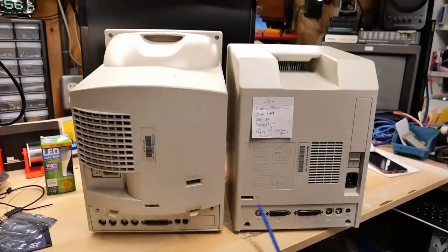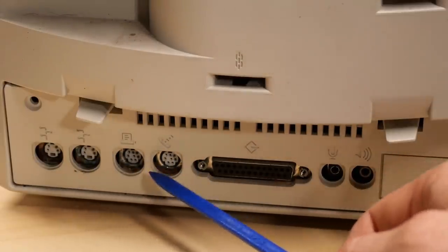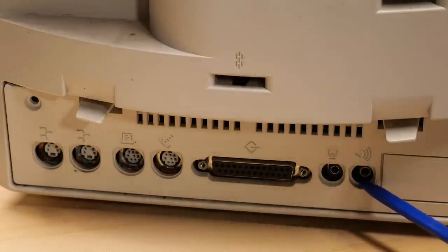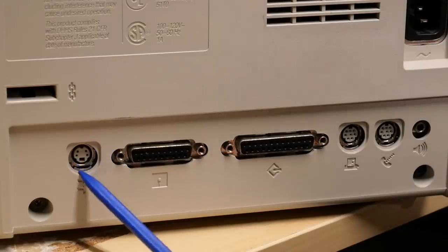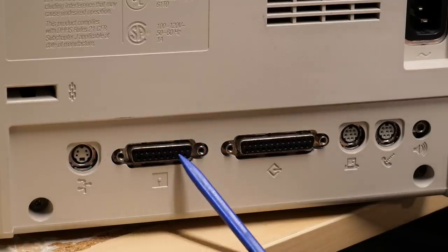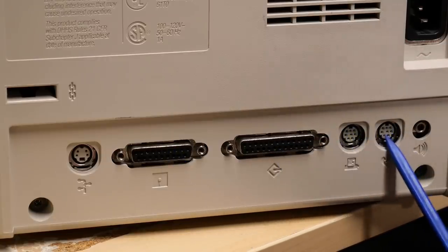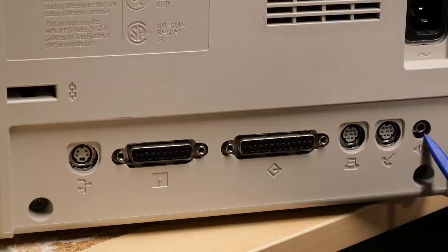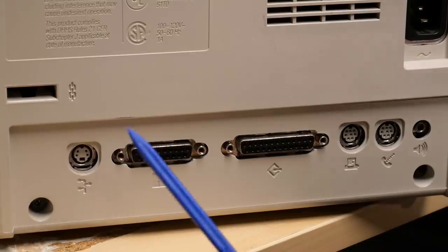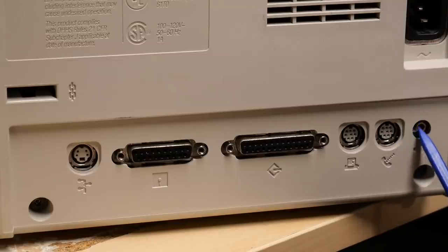From a peripheral port perspective, they're very similar. The Color Classic has two ADB ports, a printer and modem port, also Apple Talk port for the printer port, has a SCSI connector and a microphone input, and a headphone output. While the Mac Classic only has one ADB port — the Macintosh SE and SE30 actually had two. The original Macintoshes had an external floppy drive port, which was dropped on the Color Classic; there's the same SCSI port, the same two serial/Apple Talk ports, and a headphone jack. On the Classic 2, it actually has a microphone jack, but on the original Mac SE, SE30 and things before that, there was actually no sound input at all — it only had sound output.